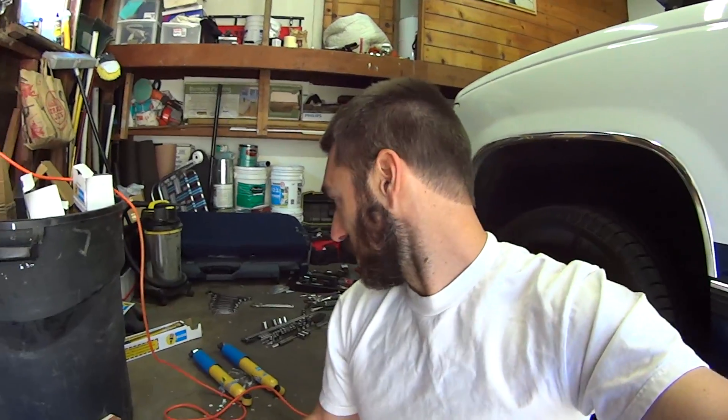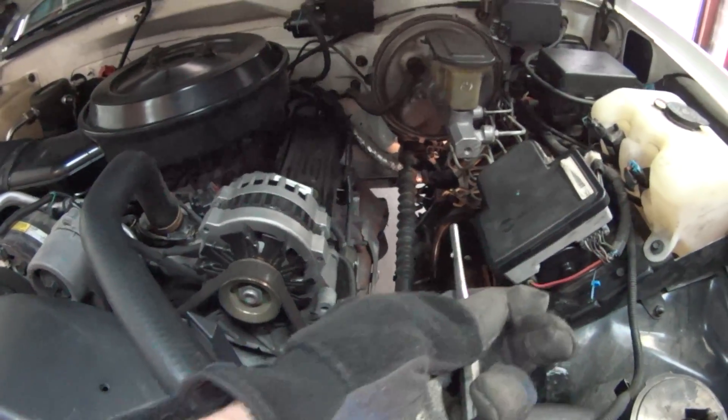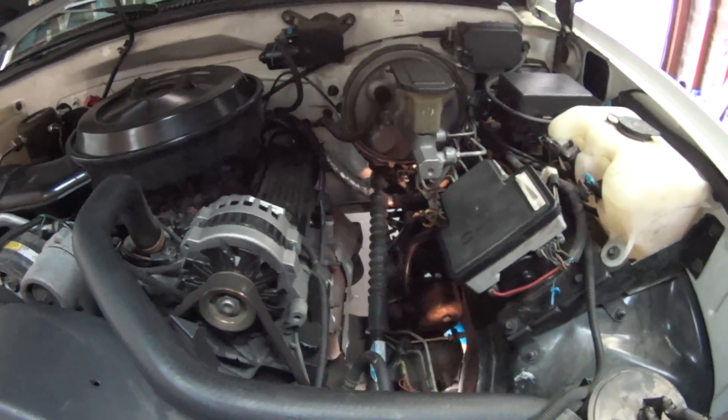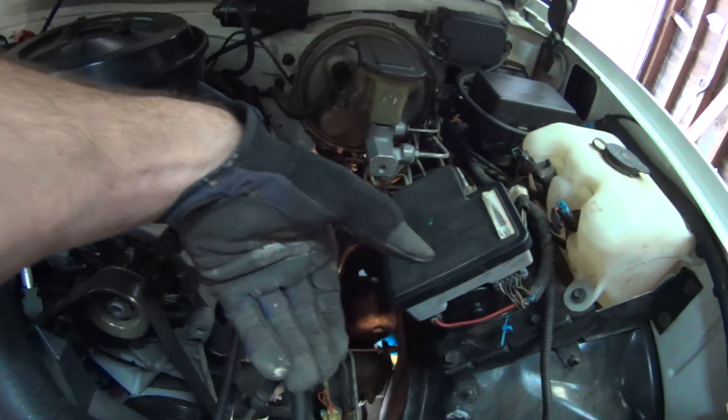This should be a major upgrade with the new Bilsteins. I slid the new shock up into position into the upper shock mount. I used a small tool to put it in there and adjust the hole for the bolt to go through. I was able to reach deep in there, grab the body of the shock, and adjust it while using my other hand to slide the bolt through. That process took about 10 minutes, but it wasn't hard — just figuring out where the hole was in the upper shock mount to get everything to line up. I slid the bolt right through and started the nut on there so the bolt doesn't slide back out.